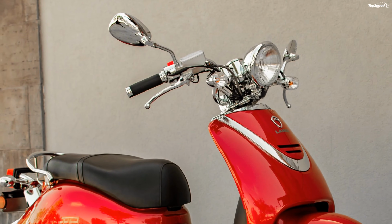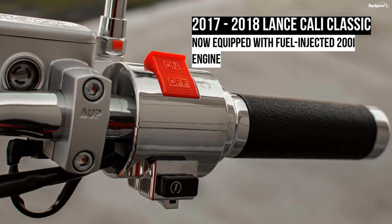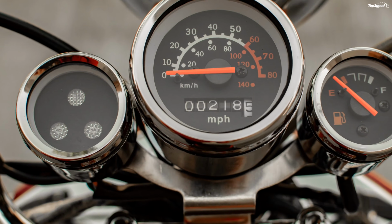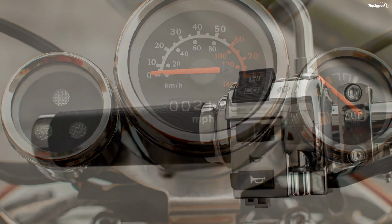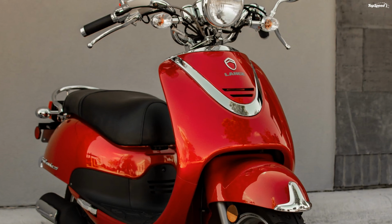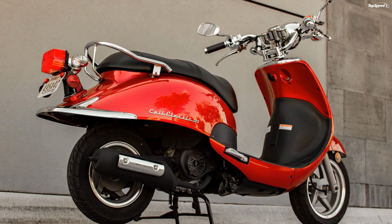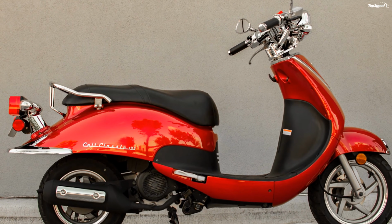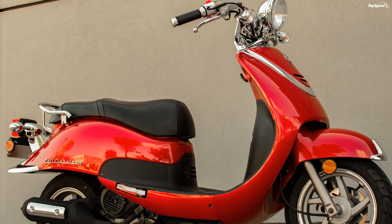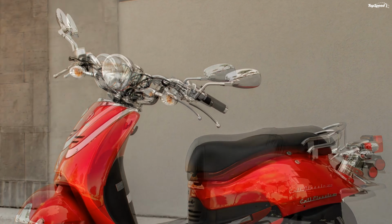Motorcycle-style telescopic forks float the front end while a coil-over monoshock tames the motion of the swing-mount drivetrain. We see a little difference within the family members when we get to the running gear. The 50 and 125 models run the same 12-inch cast rim up front complete with a 110/70 hoop and 180 mm hydraulic disc brake, but the disc on the smaller two models is of the vanilla variety while the 200i sports a 190 mm wave-cut disc.